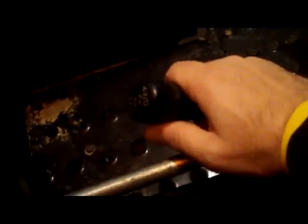If you rotate the rear wheel slightly back, this will eventually, as you rotate the drive line, cause the splines to line up, and it will move up into the four-wheel drive position. Now when you rotate this drive wheel backwards with the other wheel chocked, not only are you turning the drive line, but you're now also turning the entire four-wheel drive transfer case mechanism of the tractor.